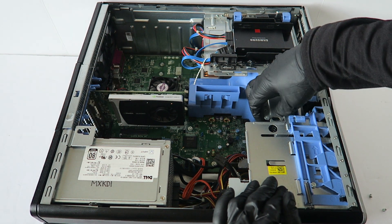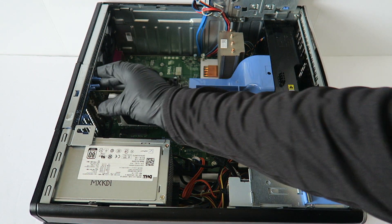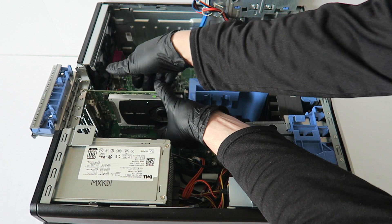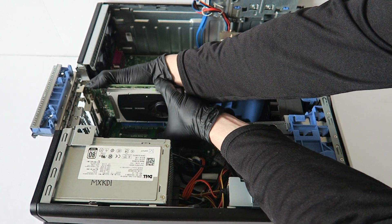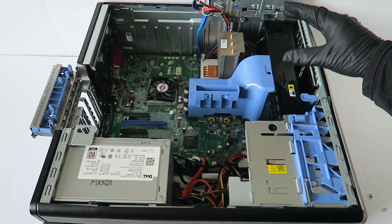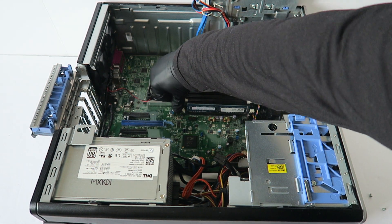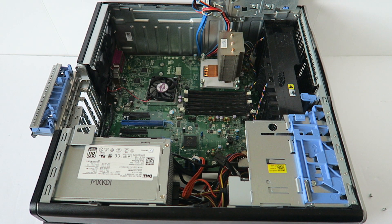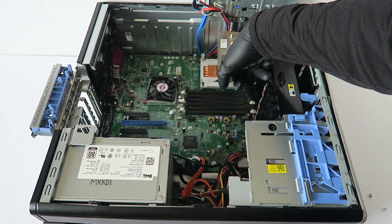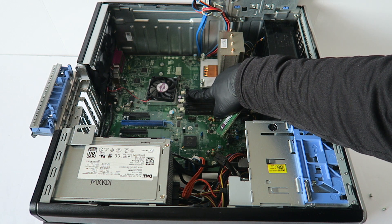Now I'm going to lift this up, and I'm going to move the video card. At the same time I'm going to be upgrading the memory — it's using ECC memory DDR3. The memory DIMM slot 1 is the white one, DIMM slot 2 is the next white one, and DIMM slot 3 is the third one right here with the white connector.